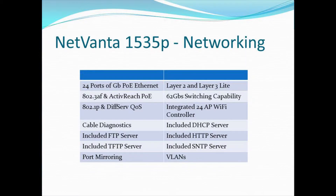It's full layer two and some layer three. Layer three light really amounts to 16 subnets that you could create static routes to address, which really fills the void for most smaller businesses that need layer three functionality. It does Power over Ethernet — 802.3af — as well as ActiveReach PoE.